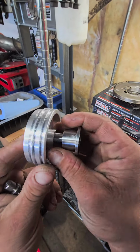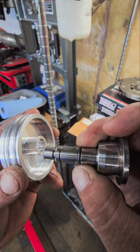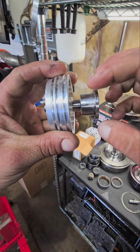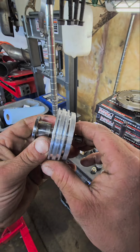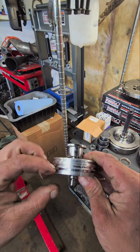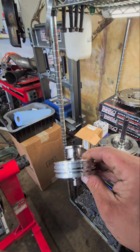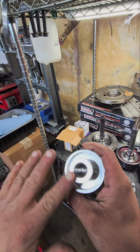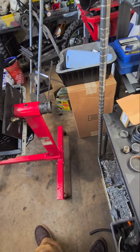Obviously, you're going to transfer over your spring and stuff. But I like to get the Sonics version, which has an O-ring on it, and it's that much better. Where it's going through the billet piston, it's got an O-ring to seal it even better. Really nice part. The problem with the factory low reverse pistons is they're really short, and they like to cock in the bore sometimes when the band gets pretty worn and it hasn't been adjusted. When they cock in the bore, they like to crack down the middle, or you'll get the part of this that cracks. So these are $35 on eBay. I highly recommend just getting it.